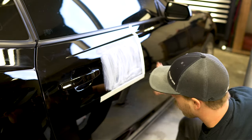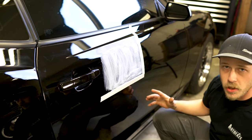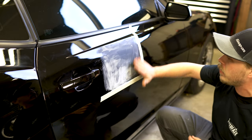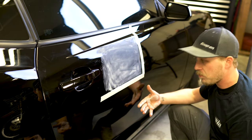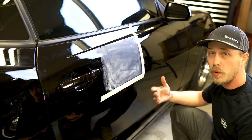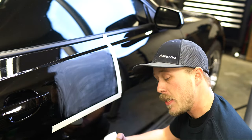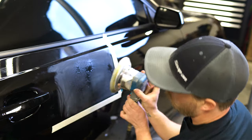For this demonstration I'm just going to do this small little area. After you do your sandpaper it'll get a little flat, which is what you want. If you wipe it off you'll be able to see what looks to be an orange peel. You basically keep going until that is off of there. You step up grit — at 3,000, 5,000, and 8,000 you introduce water, then it becomes more wet sanding than the dry sanding you have with the 1,500. I have already thoroughly done the 1,500, so now I've got out my 3,000 and my water bottle, and I'll just get the paint a little wet and proceed.